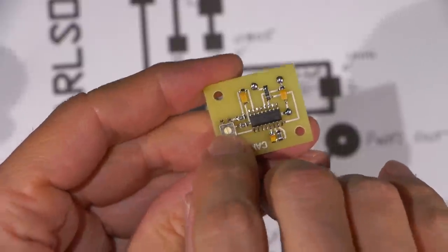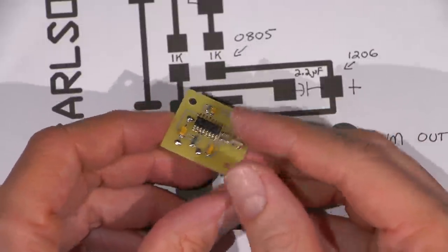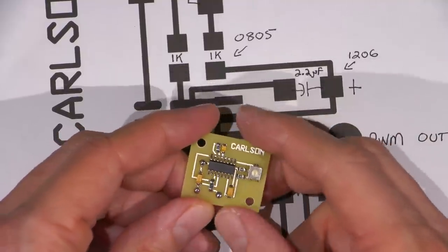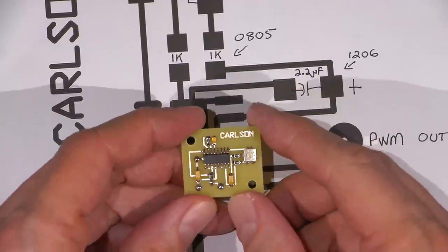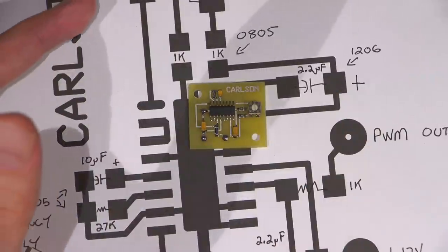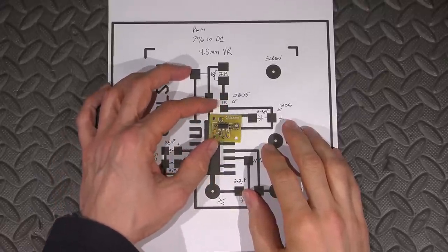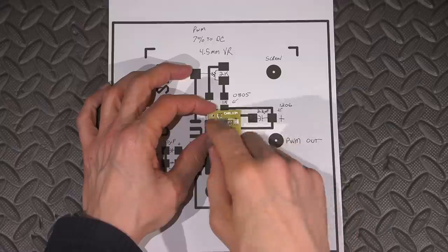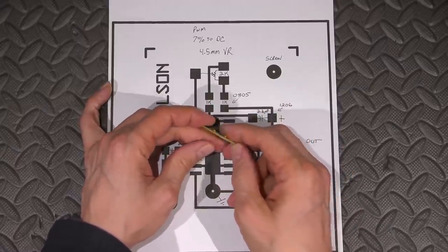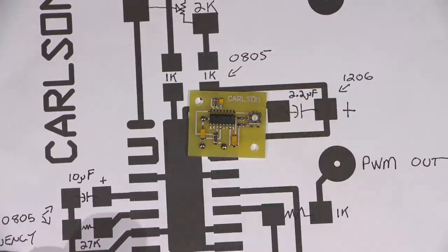Which brings me to the circuit board I've designed. This is what the circuit board looks like on a relatively large piece of paper - this is much like the circuits I release on Patreon to everybody, with a layout listing all the components, then the actual-sized transferable layout to make the circuit board. The little circuit board itself - negative, positive, and the signal that runs out to that sensor. There's a little TL494 right there - upside down but you can see it - and this allows me to adjust the width.